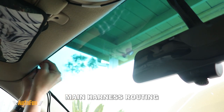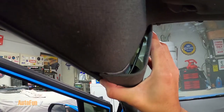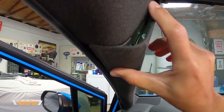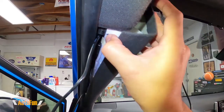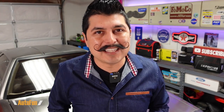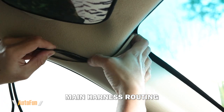It is important to notice that at this point the cables are going to run through areas that might have airbags on the vehicle. I have made a separate video showing the potential dangers an installer faces when working around airbags or putting cables over them, and how I get around that issue — I'll put a link to that video in the description below. This car doesn't have any airbags, so I can continue routing.